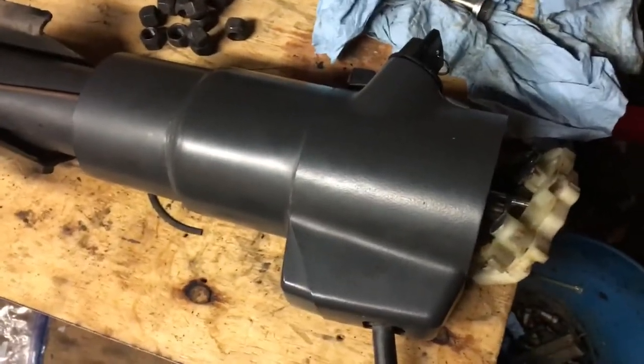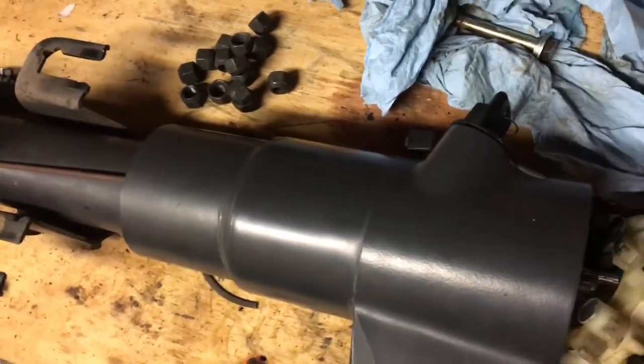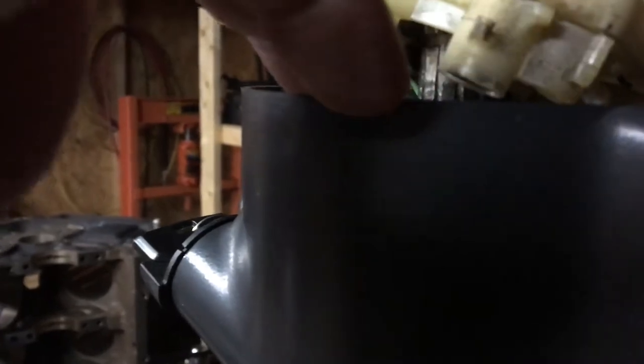Once you get the new parts back in place, you have to put it back together the same way you took it apart. Put this housing back on with the three screws in here. What I did was I took the housing and stood it up right like this. The housing is standing up like this, and I dropped that metal plate I was telling you about down in this hole and oriented it — you can kind of tell from the way it's shaped how it goes — to sit down flat. Then I took this housing and put it down over the top of the steering shaft, the steel shaft of the steering column. Put it down, lined up all the holes, then put my four hex head bolts back in there and started them and tightened them down.